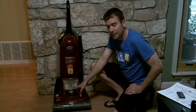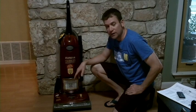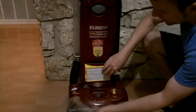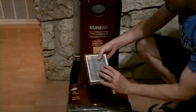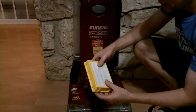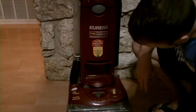Basically, all we're going to do is change the HEPA filter, change the motor filter, and just give it an overall cleaning, and then change the belt. To get the HEPA filter off, it's real easy — you just pop that cover off here. This one's probably been on there a little longer than it should be. After a while it just gets plugged up and starts taking away from the performance of the vacuum.